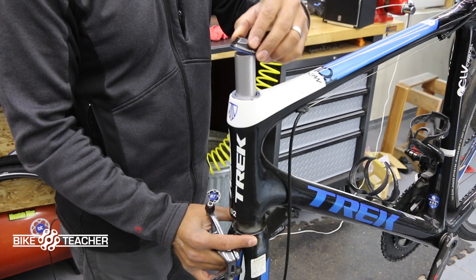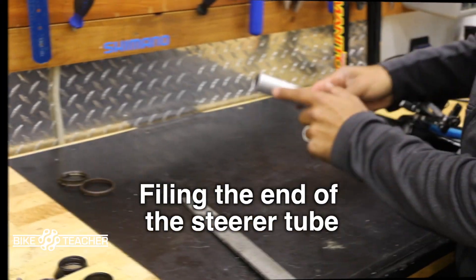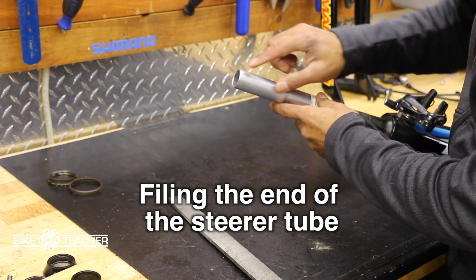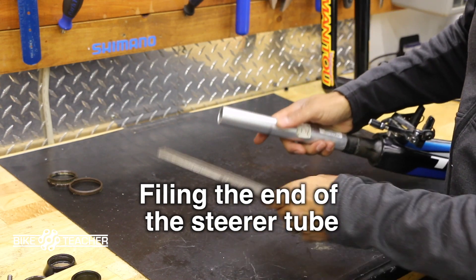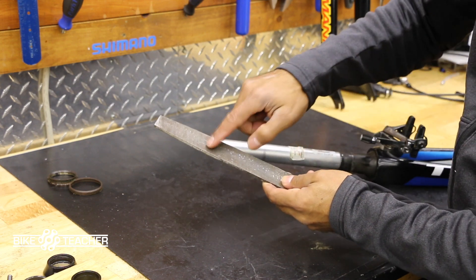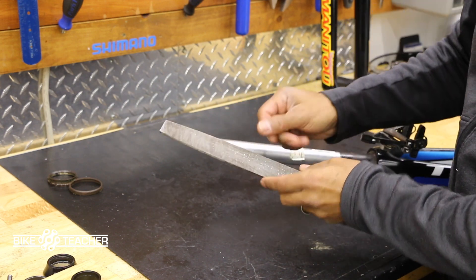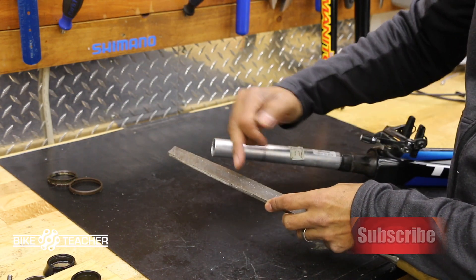You also want to make sure that the top edge of your steer tube is rounded — nice and soft, no sharp edge — because a sharp edge could actually cut your o-ring located inside the compression ring when you slide it on, since it gets pressed on and can be tough. Make sure this edge is nice and soft, get a file and round that off. Then go ahead and get a real thin coat of grease and lubricate that o-ring. I turned this dust cover upside down — there's our compression ring with the split, and that blue line inside is the rubber o-ring. After you make your cut on the steer tube, go back and file this edge to take away the sharpness.